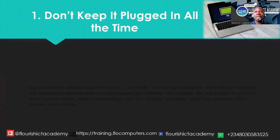Let's start with a common mistake a lot of people make, especially in this part of the world — in Africa, regions where there is no access to 24/7 power. A lot of people keep their laptop plugged in all the time. It feels logical, because if it is at 100%, you are not going to run out of battery. They keep it plugged so that when there is no power, the laptop battery can help them work for longer hours.